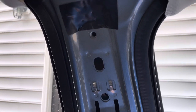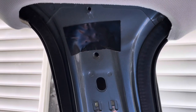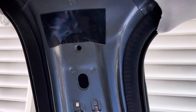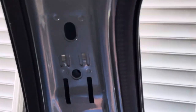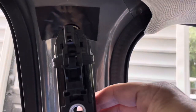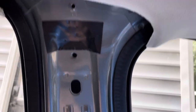I originally had thought it was the rear door panel, and I have taken that door panel off twice, taped all the wires together, put towels in the door thinking it was maybe something rattling inside, and I could never get it to stop. I saw some videos of folks saying it's possibly the B-Pillar, so I took the B-Pillar panel off. I did think it was initially this part here, which is what helps your seatbelt slide up and down. This thing rattles, a couple other things rattled, and it was nothing.